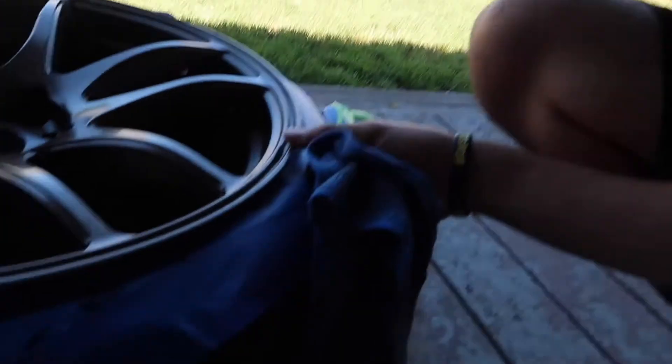After you've sanded the surface and it's smooth — I smoothed it out pretty good, the texture feels like the wheel before it was curbed — grab your water-based product and spray down the areas where you sanded to get all that debris off. After you wipe off the wheel cleaner, grab the spray paint, shake it up, and do a light coat. The first coat always has to be light — that's the basis of the paint. The first three coats are gonna be light, then after that you can go heavier. Let's get this process started.